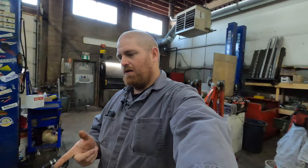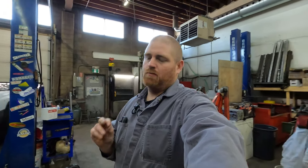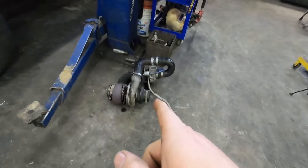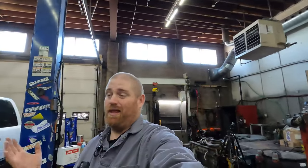5x18 injectors that I built. But the camshaft that's in it is a little bit too much camshaft to suit me, so we're going to pull that camshaft out. And we're going to put a stage 2 camshaft in from the guys that I deal with for camshafts. So I took the compounds off yesterday because we're not going to use those compounds. We're going to build a different set of compounds because apparently I'm like that.